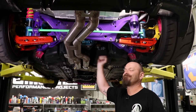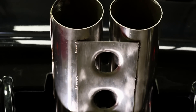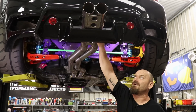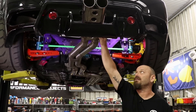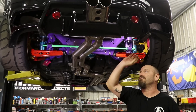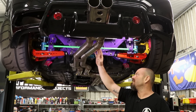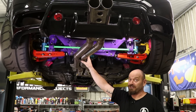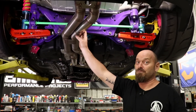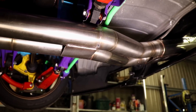For the exhaust there's no muffler — I put a couple of resonators in but they don't really do much. We've gone with center exit mainly because it looks cool, and that's what it's all about. The tips were actually on the vehicle previously when it had the FA20 in it, and we recycled them because someone put a lot of effort into the plating of them. I've modified and reused them, matching them to the twin three-inch exhaust. Routing clearance required some modifications at the rear of the car since it was never designed for twin three-inch pipes, and it's a very low car — a lot of time and effort went into keeping the exhaust away from the road.